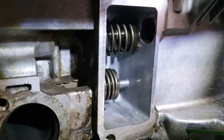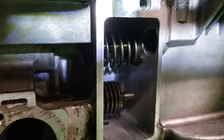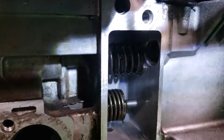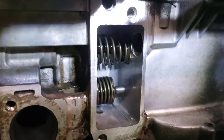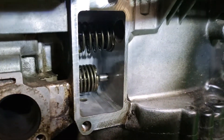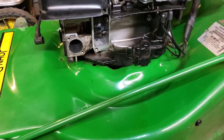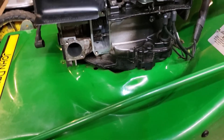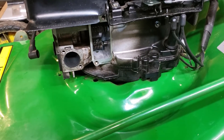I'm just gonna do this first one — take the spring out and make sure that the valve clearance is correct when the piston is at top dead center, get the valve stem ground properly, and we'll put her back. With the tool it's the same process to reinstall. This tool is very much worth what you pay for — it makes it super easy. I did this in mere seconds versus using a small screwdriver and needle nose, which is messing around for minutes. This tool works in seconds.